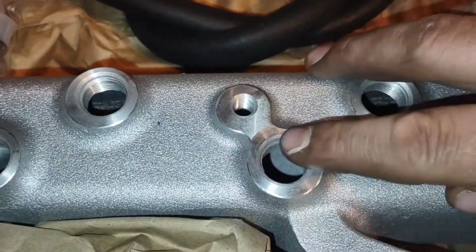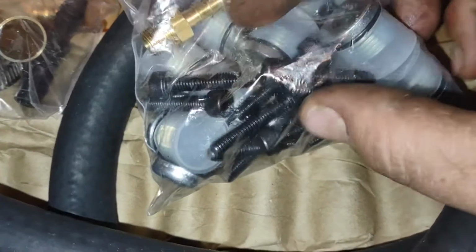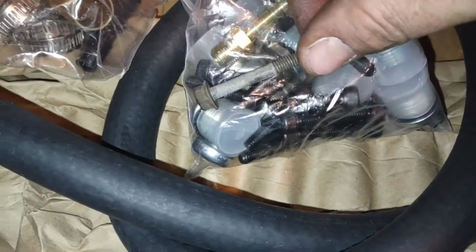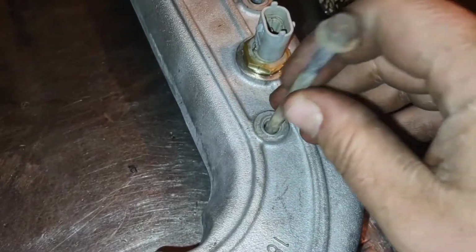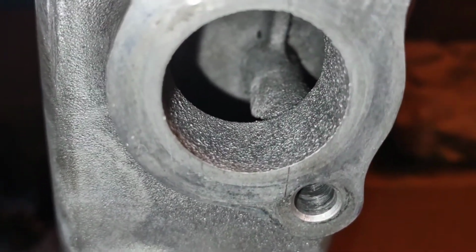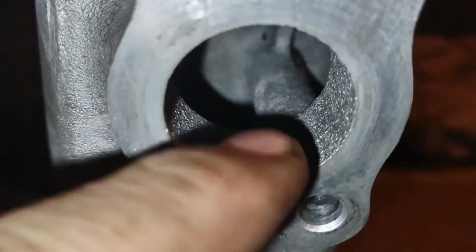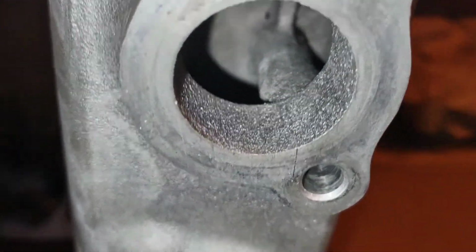And the other thing that's interesting about these is that these bolt down to the engine in a different way. So they have much shorter bolts here that hold the intake manifold down. If we compare that to the factory one, on the factory manifold here, the bolt actually goes all the way through the intake manifold. And on the inside of the intake manifold, there's these like columns, if you will, that go through the intake manifold that actually disrupt the airflow.